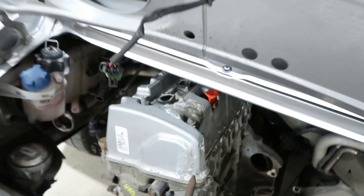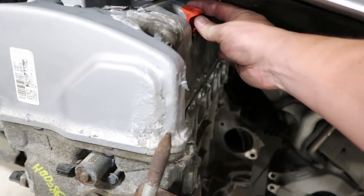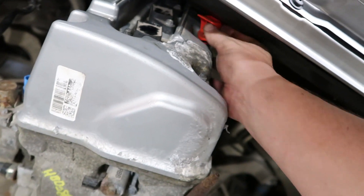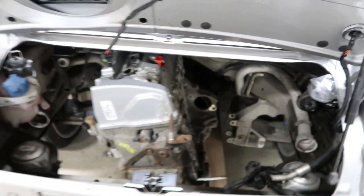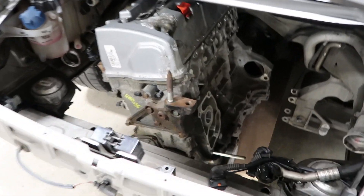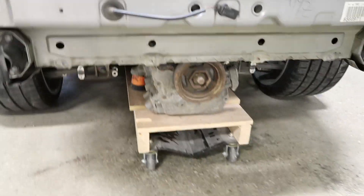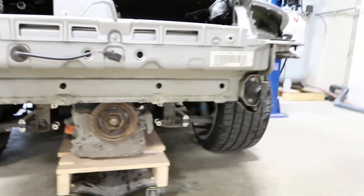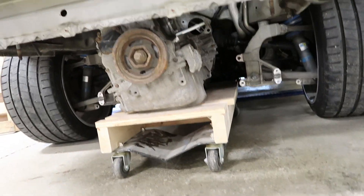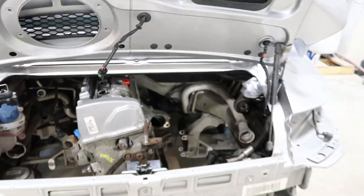The dipstick is slightly different on the CRV valve cover as well, so I'd be able to get the dipstick out. I think technically I could get it out with a K-Tuned different dipstick too, but this looks super promising - there's tons of space. The oil pan clearance is good, equal to what it was before, and it's not touching the top of the engine bay. I think I'm in good shape - this is definitely doable.